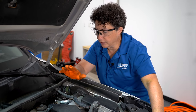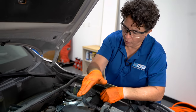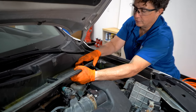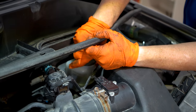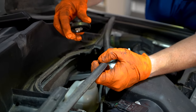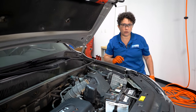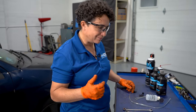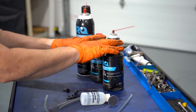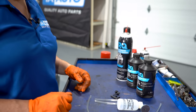We start always at the master. First things first — fill it and make sure it's full. So the master is topped off and full. Make sure you put the cap back on, then we're going to raise the vehicle and start on the right rear, because the master is in front of the driver. Here we are at the right rear wheel, which is the passenger rear wheel. Here's the kit — you get two cans of brake fluid, brake cleaner, and all the attachments and hoses.